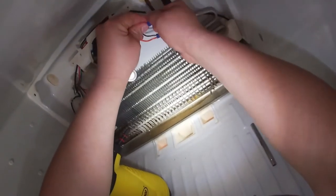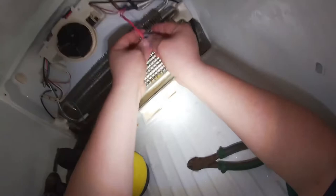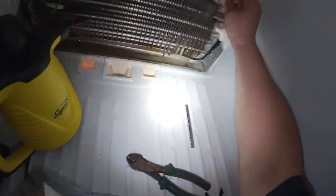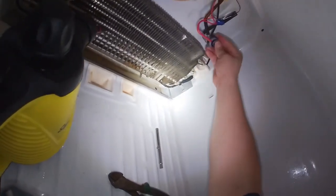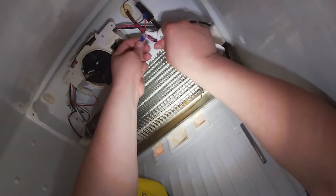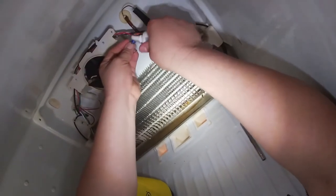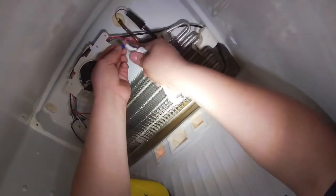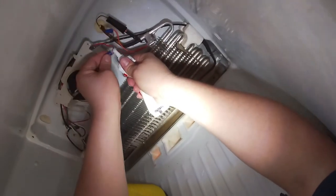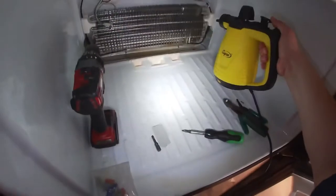All the buildup ice was caused by the clogged drain line. You can see how I'm replacing this thermostat — there's a link in the description of this video. If that thermostat didn't check okay, we put some wire nuts and apply silicone on the wire nuts, because we don't want any humidity, condensation, or water getting inside those connections. You can use any silicone to prevent water from getting into the connections.